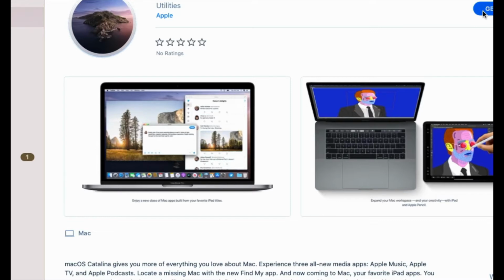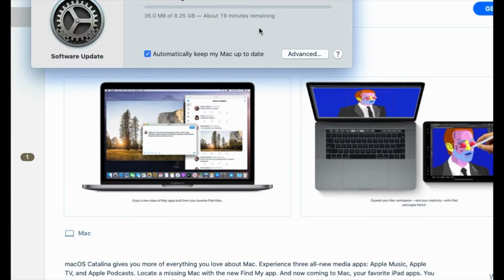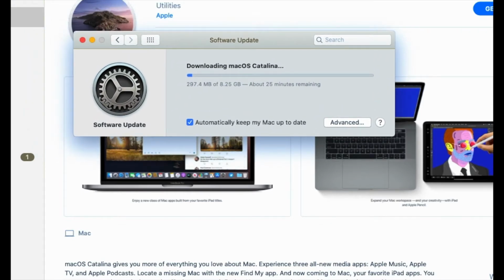After downloading, I don't have to create a bootable USB to install macOS to my 1TB SSD since I've connected it to my MacBook as an external drive. However, I will share later on how I managed to create a bootable USB for macOS Catalina. Okay, going back, I went ahead and installed macOS Catalina by following the prompt instructions and migrated all the files from my 512GB drive to my 1TB drive. I have to admit that my enclosure hung up on me, so I had to restart the MacBook and the process restarted where it left off.